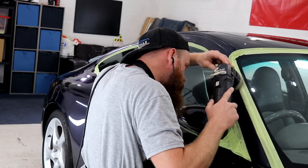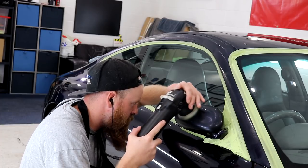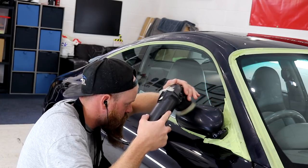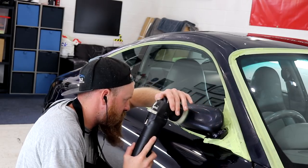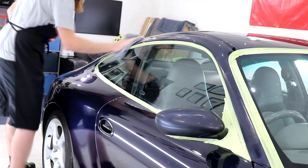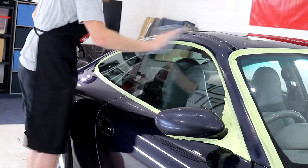Again, with these smaller microfiber cutting pads, you will want to brush them out frequently and only use the amount of product that you require. With these pads being a lot smaller, they do build up heat a lot quicker, so you do have to be a bit more careful. Typically, with the harder types of paintwork, this simply allows you to cut the defects back a little quicker, but for softer paintwork, you need to take more care. The Mini Bigfoot was deployed on all medium-sized areas on the Porsche, and with myself spending enough time, I found a superb level of defect removal.